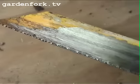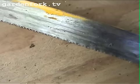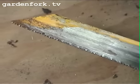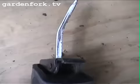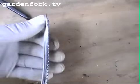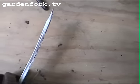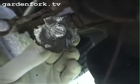Ow, that's really hot. These saw blades for our saw, they wear out very quickly. So if you see here, this is only after a couple of minutes. So you're gonna go through a number of blades just to get this bolt off. The beauty of this kind of blade is when you bend the blade, you just give it a twist and it's marginally straight again. And you just keep on using this until you break all the teeth off. So we cut that through. That's a beautiful thing. Now we gotta get the bolt out.